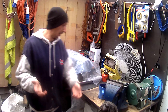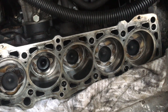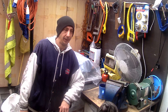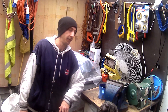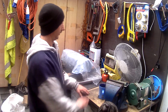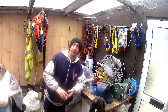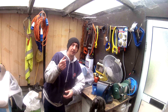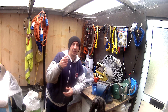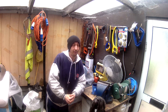So instead today — last time I sorted the block out, I just cleaned the bores and topped the pistons and we pulled that bit of O-ring, that bit of sealant out, which is terrible. I really don't know why. I don't think this block's correct. Fingers crossed, everything touched wood. So today I'm going to take the oil filter off, remove the nut, take the oil cooler off, and then I'm going to replace that O-ring and clean it all off around the back of the engine. Rather than waffling on, I'm just going to crack on with it.